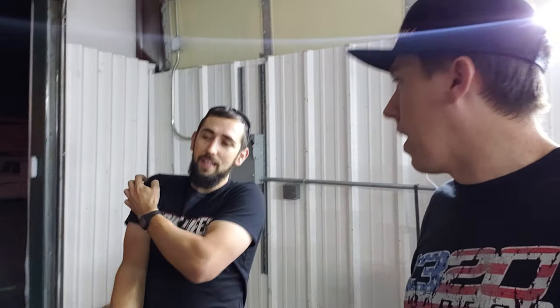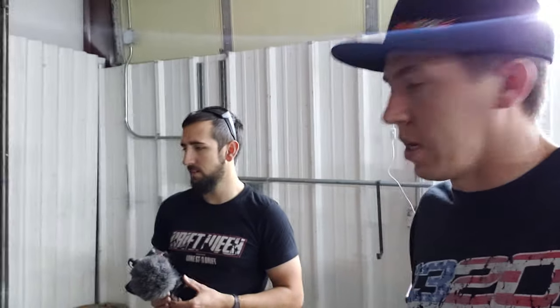We were already close to 900 — we could maybe do something else. What will 35 or 36 pounds do? Until you find the limit and then go from there. I kind of only wanted 800, and it went past that. You learned a huge amount on the tuning side with the ECU Masters ECU over the last two nights on the dyno — setting up safety parameters, watching it go lean, being able to change that. TPS stuff: always going to throw another one of those in the tool bag, because that'll wreak havoc on the whole system. Thanks to Trevor for bringing the car over — I'm sure this isn't the last time he'll be on the dyno. See you guys next time.